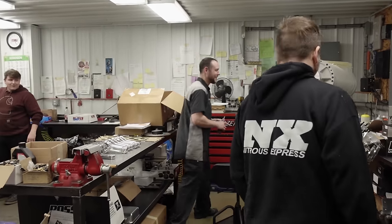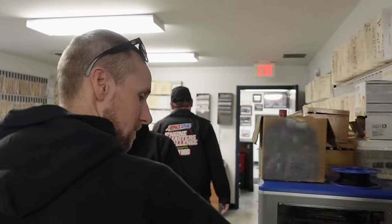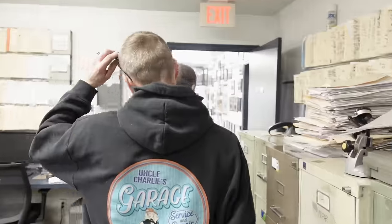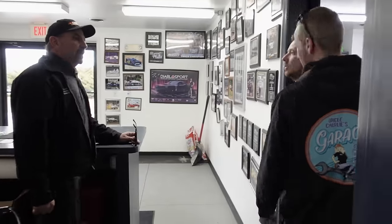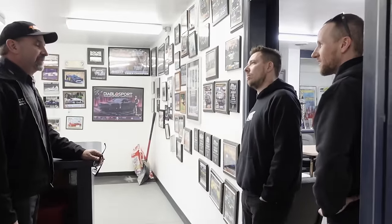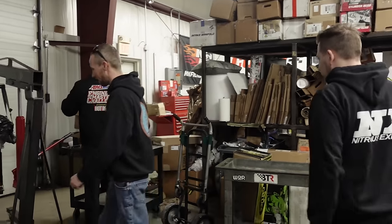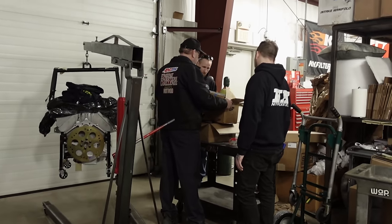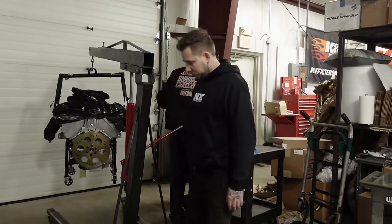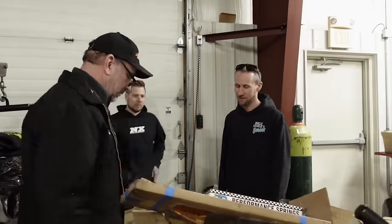Good luck. It might not hurt to get some spare pistons because you have none. You had four spares and we used them all. But I don't think we ordered any. Go ahead and order them — get at least four. You think you should just get a full set? I need eight. But the other two should have been decent, good enough that I could have slapped one in at the racetrack. The skirts were collapsed. They weren't burnt. What causes the skirts to collapse? Running it hard — they just got rattled a little bit.